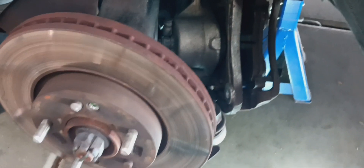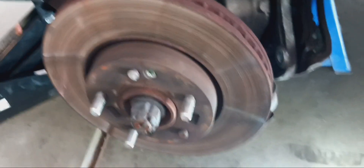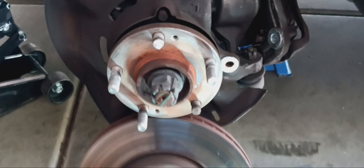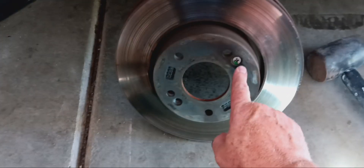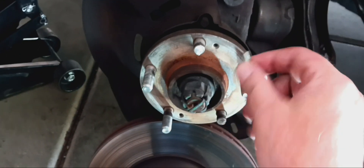So I took those off and if you can see the brake pads, they're not that bad. The next step is to get the rotor off, and obviously it's not going to just come gliding off easy, so you get a nice rubber mallet and just kind of tap it around to work it loose. Also I forgot to mention — there are two screws that are threaded through that kind of hold it on, so make sure you unscrew those first before you start tapping.